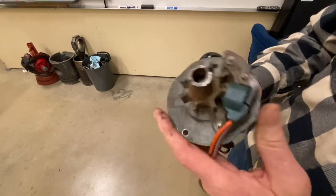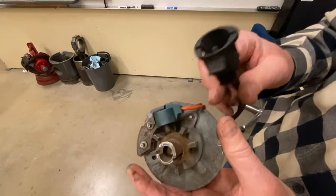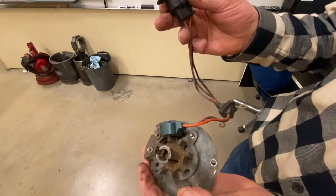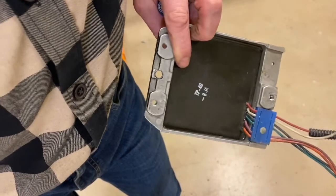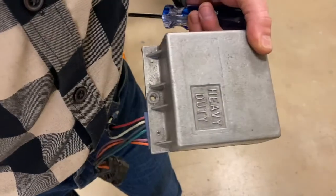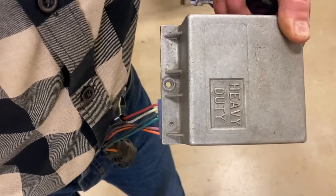It was pretty important that these wires remain intact. Sometimes those wires would break internally, and if they did our ignition system would fail. We could go inside with an ohmmeter and test the integrity of those windings. Here's a Ford ignition module — inside it is a series of transistorized circuits that amplifies the signal from the pickup from the center of the distributor and can then command the coil on and off.